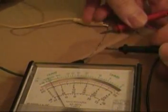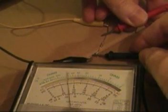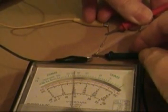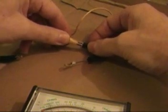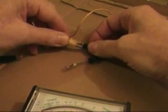I just grabbed a resistor — I don't know what value it is — and tested to see that there was some kind of voltage drop across it. It didn't really matter what resistor you use. I hooked this up to the diode forward and backwards. Hooked up backward it should be stopping some voltage; hooked up forward it should be letting the voltage through.